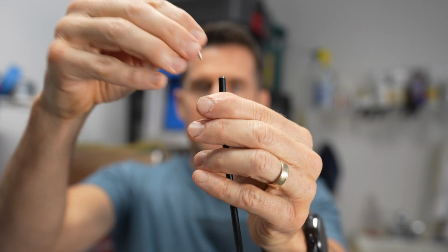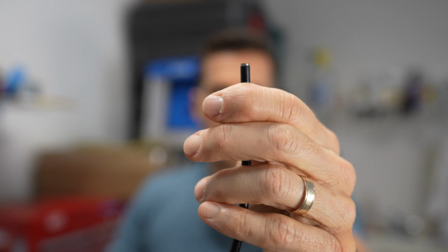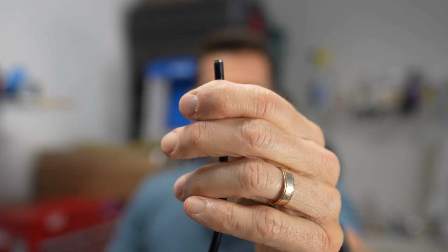You just take the hose and put it into a bench vise, or you can use the little yellow plastic things that Shimano provides where the hose goes into, and that way you can press it into a bench vise. Take a hammer, put the hose insert inside. So this is what it looks like. This is the hose that I cut. You cannot get the hose insert out. You have to have another hose insert. So just a little tip there.